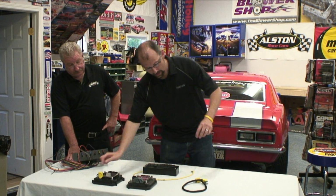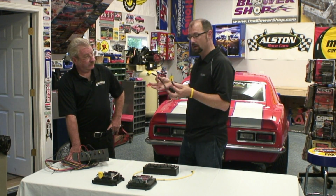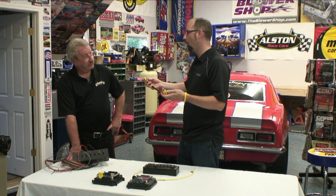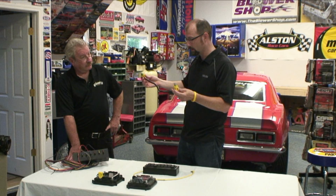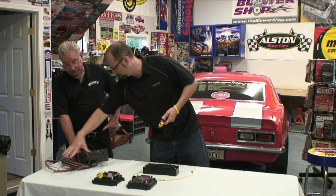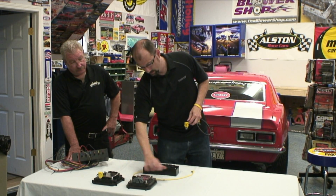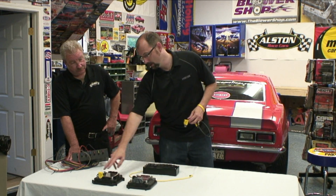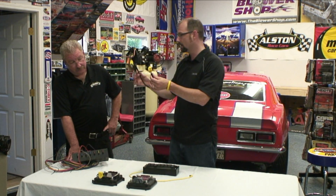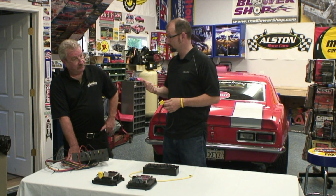The last thing that puts the two of these together is this data cable. In the kit, you get this data cable that's longer than you're going to need, so you can cut it to length if you need it. This is what connects the cells together. So instead of this big rat's nest of wire strung out through the entire car, switches wire from here to the master cell, your outputs wire here to the power cell, and this is what connects it together. So a lot less weight, a lot less complexity of wiring.